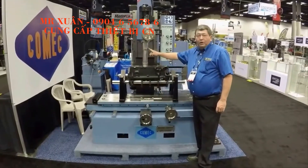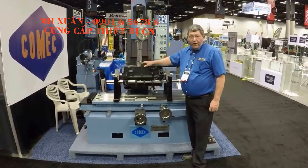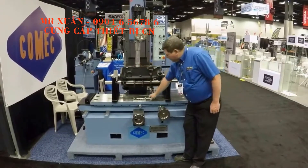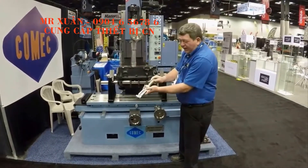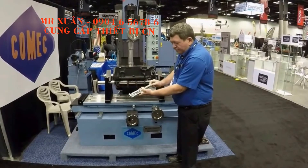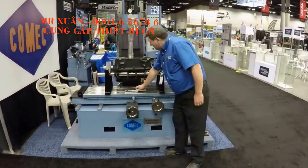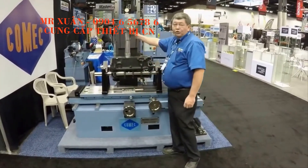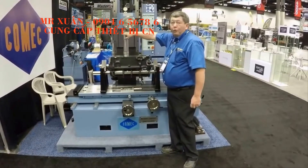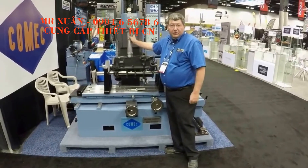This is the Comec Boring Spindle. It comes with two boring heads and has a boring range of 3.3 to over 6.5 inches. It comes standard with a very easy to set micrometer — set it and forget it. To change or to load in, all you do is four bolts and it is tight, making it easy to swap between spindles.